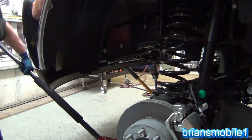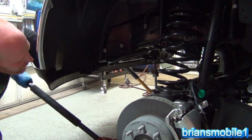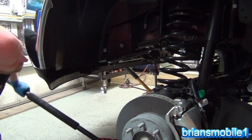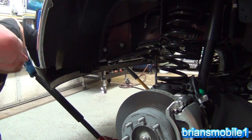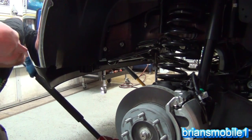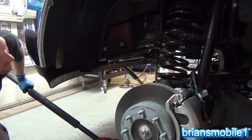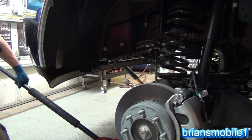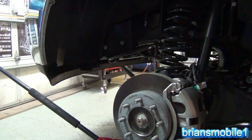Time to jack it up — we go one side at a time. I've got the tie rod put back in. I'm watching the sway bar and watching the roll of the springs. If you get one behind the other that you want to bow out, you don't want to get hit in the face with a spring. We go to the other side and do the same.